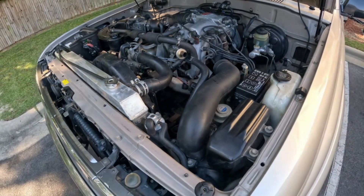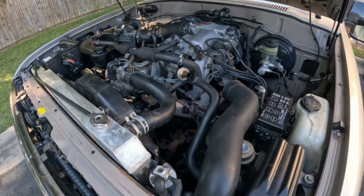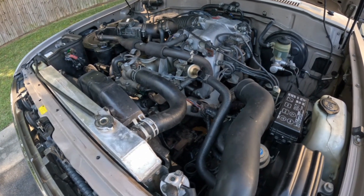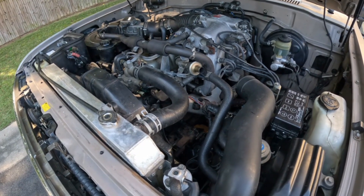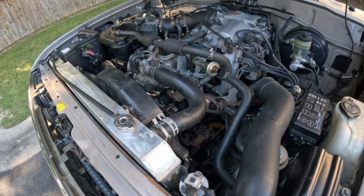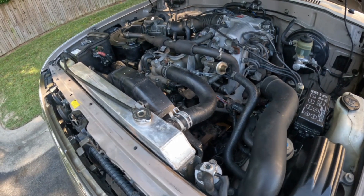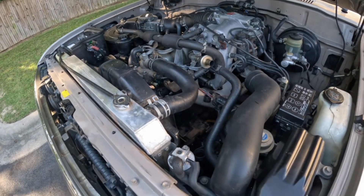This customer has the 3FE that came with the 80 amp alternator that originally had an external fan on the alternator. Some people do put an 80 amp alternator that you can buy from some of the big box stores that have an internal fan. But the big thing many people want to do is upgrade the alternator to a 90 amp, and there's a slight difference in the 90 amp alternator that Toyota makes — you have to do a little bit of a modification.